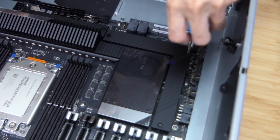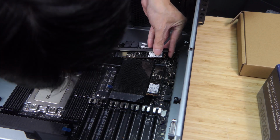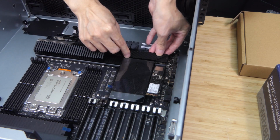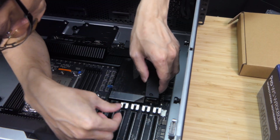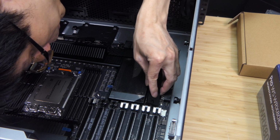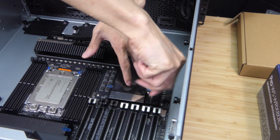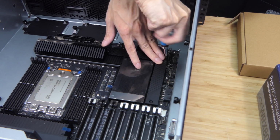We're going to use all 3 M.2 slots on the motherboard. As these SSDs are longer than your usual SSDs, we can't use a Q latch or M.2 standoffs to hold them down. The only way is to install the socket cover over them. Make sure to remove the thermoplate film before replacing the M.2 socket cover.